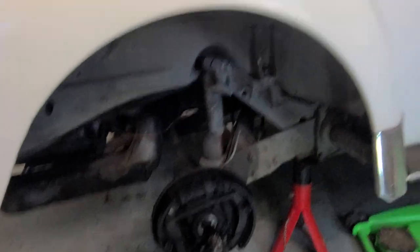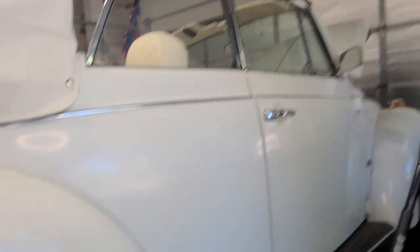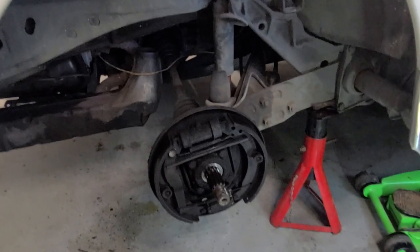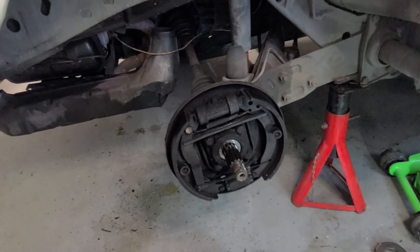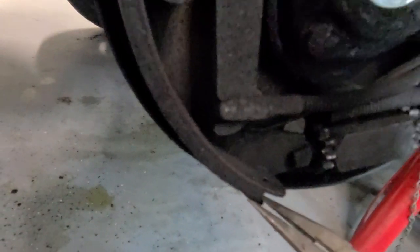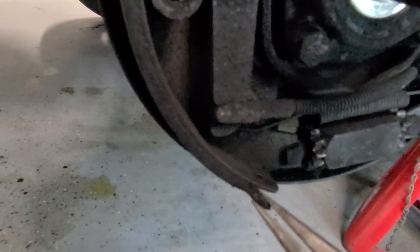Pulling the cars out of the garage - on my '79 Super Beetle, the brakes were locked. It was really hard to move the car. I finally got the wheel off and found out the parking brake had been set for a while. It had chipped off pieces of the brake shoe, and that little piece had gotten between the shoe and the wheel.